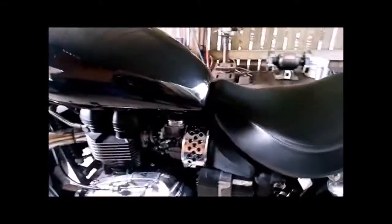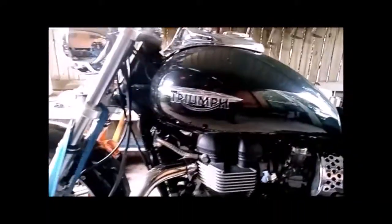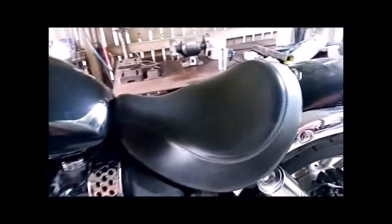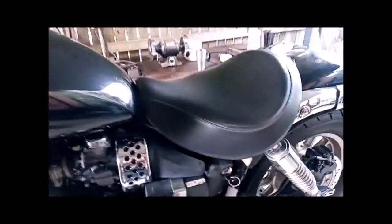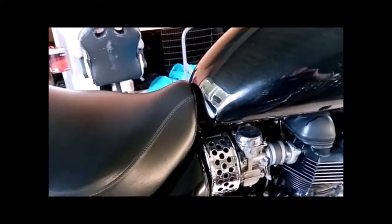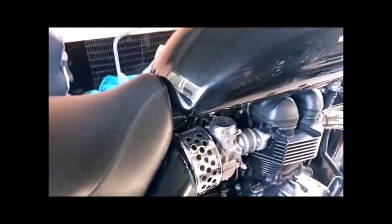It's going to get a complete rewire. There's nothing wrong with the wiring, I just don't like the way it's routed and where the relays are mounted and all that. So the standard airbox will come out, and that'll make room for all the relays, everything that I want to do. Everything will be under the seat there, and it'll be just the wires running up to the headlight and so on. I'll be using this 5mm aluminium sheet inside there, and that's what I'll bolt all the relays and everything, fuse box and whatnot, onto. So it'll all be tucked away under there.